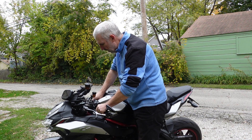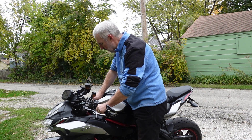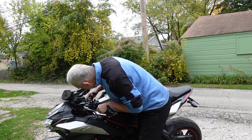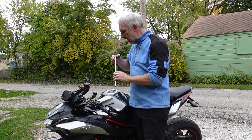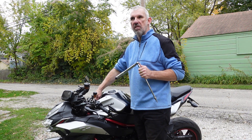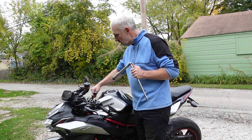Just a little fiddly because of the washers that are already in place, but that looks like it's gone in. That's the mounting bracket and we just torqued that down as well — 84 inch pounds — so looking good so far.